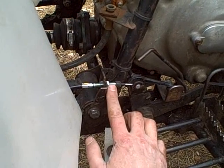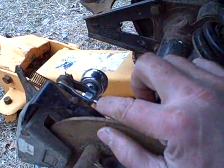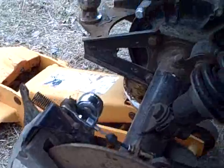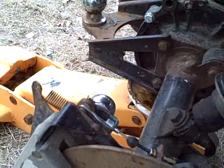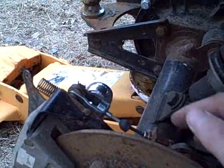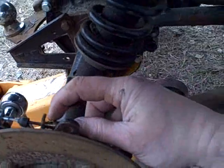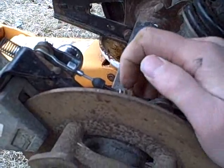With it in this position, the pedal all the way up, this arm is now sitting where it should be fully retracted. As I push down on the pedal and release it, it comes back where it should be. The only thing it's not doing is coming back as smoothly as I'd like, and I'm going to blame that on this spring — it's pretty rusted and I think it's just lost its strength. I think that's where my problem lies. I'm also looking at whether there should be a clip in that second notch right there to keep this retained in position.